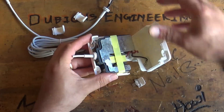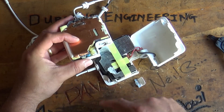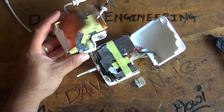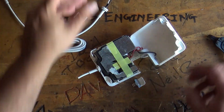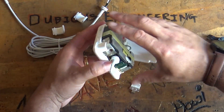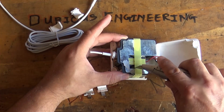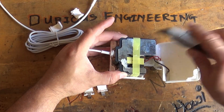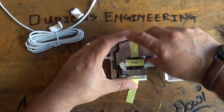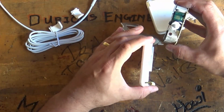The other thing I've noticed is the shielding here is quite different. We've got an aluminium shield and a little bit of heat resistant tape over the top, whereas the other has copper shields. So let's get in here and change out that cable. In order to gain access, we need to cut this tape here very carefully, just pop a little slit in it, and then peel that tape away so we can remove this from its enclosure.